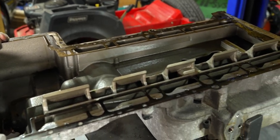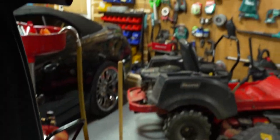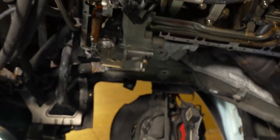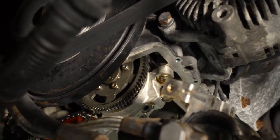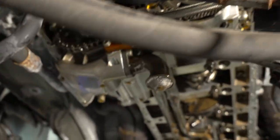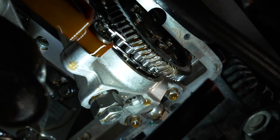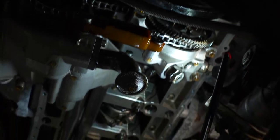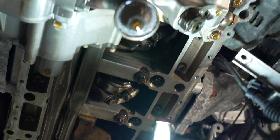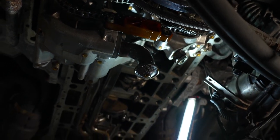Wait - I see a problem. The vanos gear - it looks like something has hit it, the teeth are smashed on it. Getting the light in here to get a better look. Since the previous owner said they scoped it, we didn't know about this. We do have another vanos gear that mounts to the crankshaft, but is there a pump problem? If we need a vanos pump, that's going to be a very expensive operation.